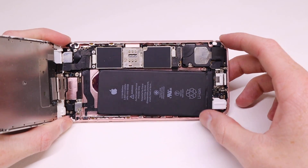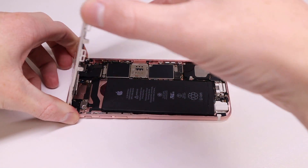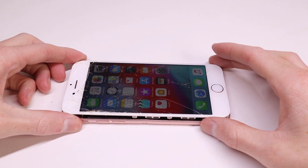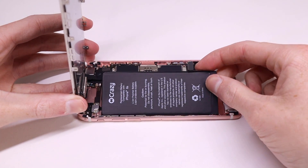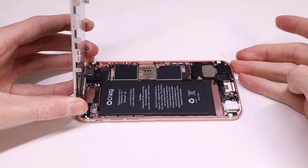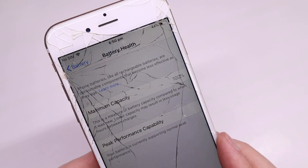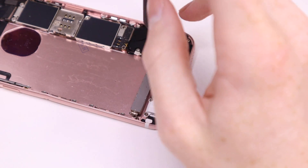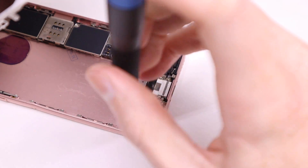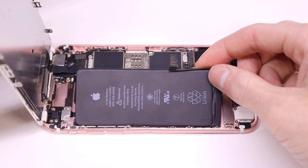It should also be noted that the cable itself is actually longer than the iPhone 6s battery, so it results in the battery sitting lower in the phone. You could get around that by bending the cable, but either way there are compatibility issues given the chips inside the battery which are responsible for protection circuits such as overcharge or over-voltage, as well as providing the phone with data on its percentage, health, milliamp hours, and things like that. The differences between the iPhone 7 and 6s batteries cause conflict with the phone itself — the chips can't communicate properly, so they're not compatible in that way.